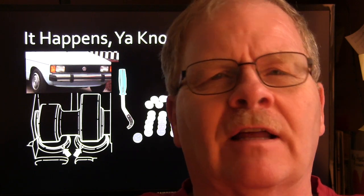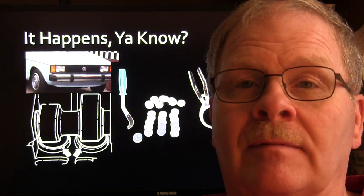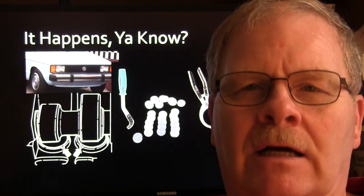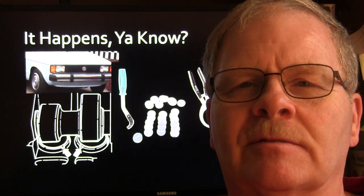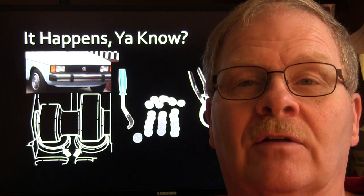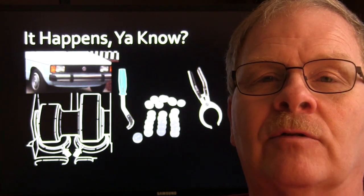Most of the time it would have numbers on it so you could tell how thick the shim was, and you could add one a little thicker if there was too much clearance, or a little thinner if there wasn't enough clearance. I had done a lot of these, and they were just routine. We only charged $18 to do a valve adjustment and replace the intake gasket. Now this was in 1983, so the prices weren't where they are now. It was a pretty good bit of job.